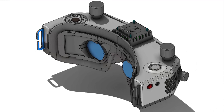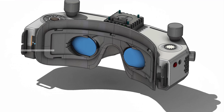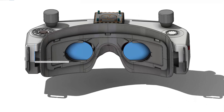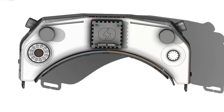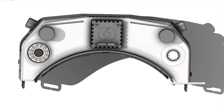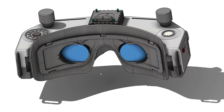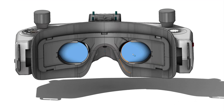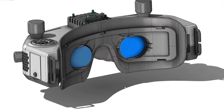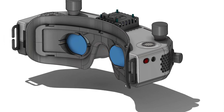Moving to the back, there's a metal clip and metal bracket for a goggle strap, which gives it a bit of class. There's an air intake here that will help supplement airflow from the top fan blowing down. There are going to be two different faceplates available — a flat faceplate for Asian faces and a more curved faceplate for European faces. There's also an optional diopter prescription lens insert, added by community request, which is a slightly different size than Fat Shark style goggles in order to cover the entire area of the bigger optic.